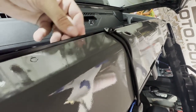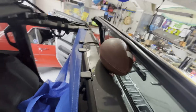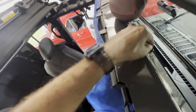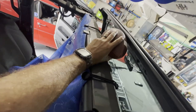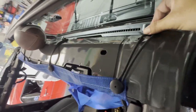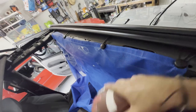When you're clipping, make sure you're inside of your plastic header panel — you can see this guy sitting nice inside, just that 90-degree turn gets the top on there. We already got the two on the driver's side; moving over to the passenger side now — grab that guy just the same, give it that little turn, and that's all it takes. That little 90 locks it in pretty good. Thanks again Harvey for the football method. This last one — clip it on there, give it that little turn. There you go — all four attached. Now she's going to flow backwards, but we started with the windshield. I'll go ahead and remove the football, put the windshield down, and put those bolts back in right now.